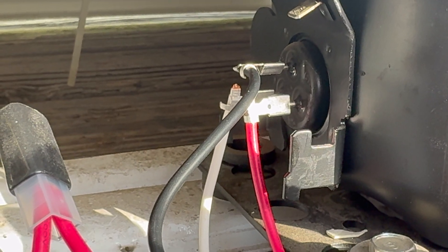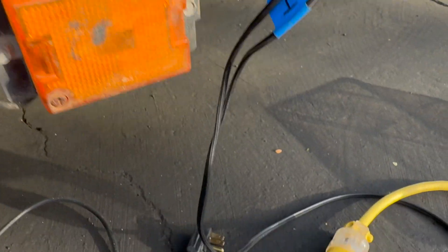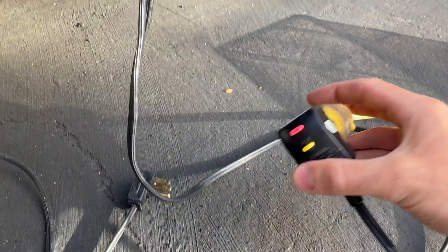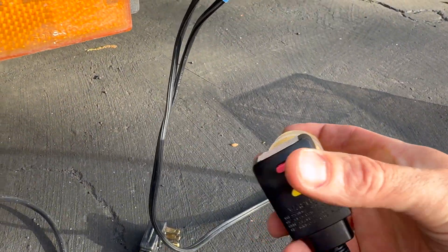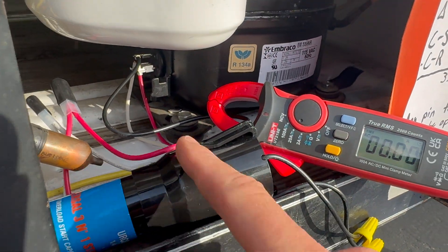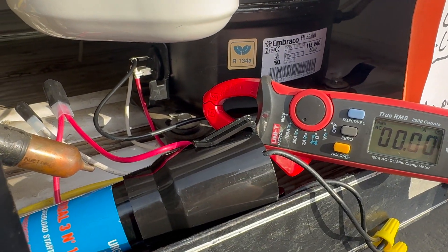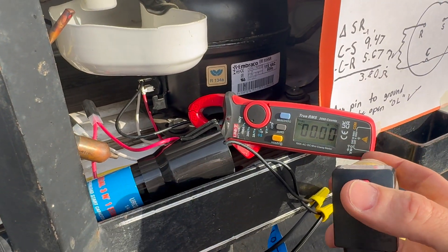It comes with a wiring diagram on the package. Normally the input lines come from the original freezer control board to the compressor. Instead of those lines, I've got it wired up to what I think is an old hair dryer plug — it has a reset and test button, so I can manually trigger the compressor on and off instead of relying on thermostat logic. Connections are made to the compressor and the hard start device. I've also got the clamp meter on the common terminal to see total current going to the compressor.